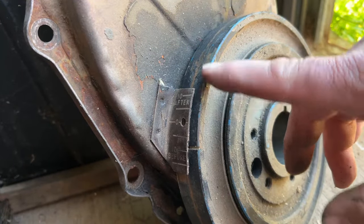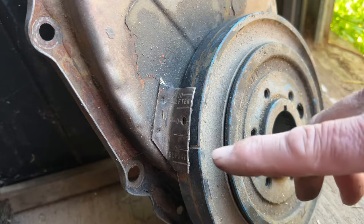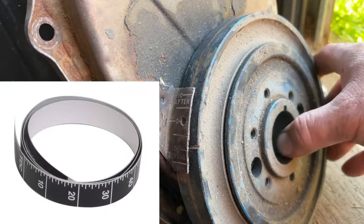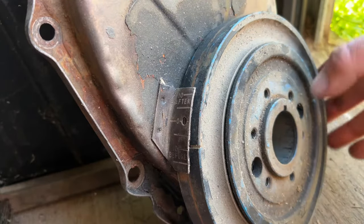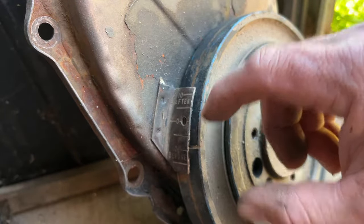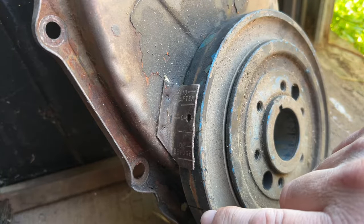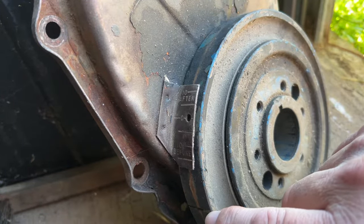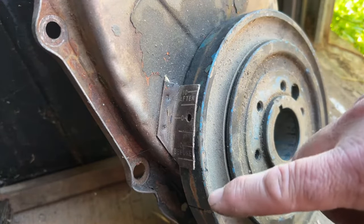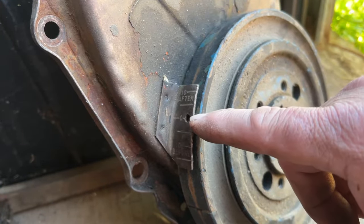For performance there's a lot more involved — you want to go and find total advance. Total advance is difficult to do with this type of harmonic balancer and timing marks. What you would need is a piece of tape on here, because if you were gonna run the engine at higher RPM — say 2,000 RPM — to get past the mechanical advance on the distributor, this timing mark is gonna come down somewhere and you're not gonna be able to see it. Even if you do see it, you can't tell if that's 32 degrees or 27 degrees. So what you would do is put a timing tape on your harmonic balancer, which would have marks across it — say 30 degrees or something like that.